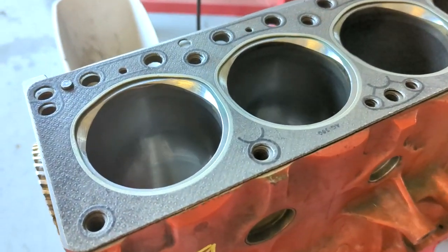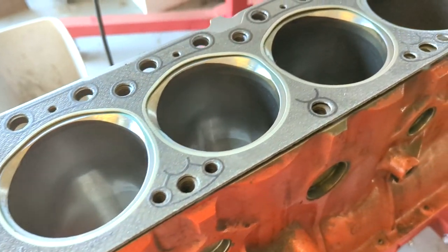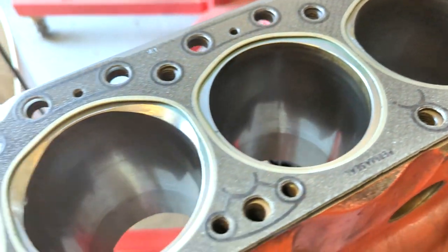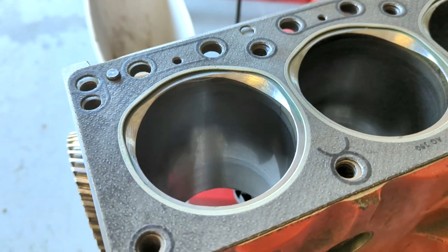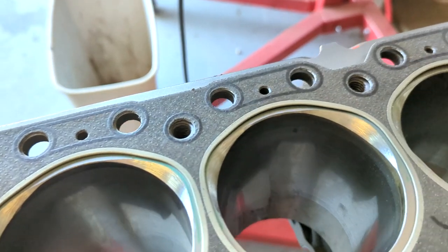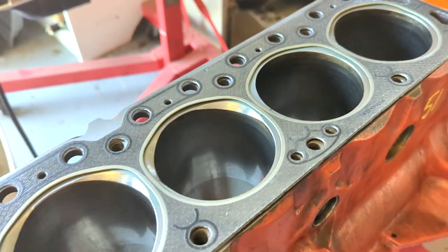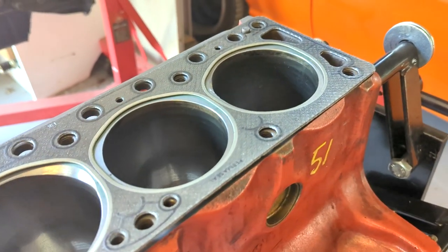Just so you can see it - here's the gasket sitting on now. You can see what I'm doing, relieving those areas out so that it gives that clearance and unshrouds that area of the valve up into the head. The valves are looking good. I'll get into it and finish these two off.